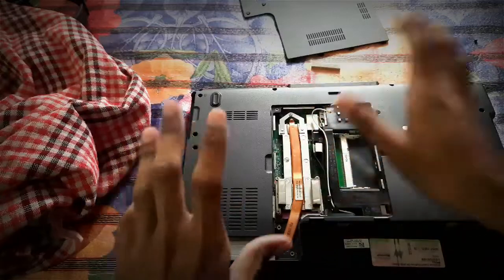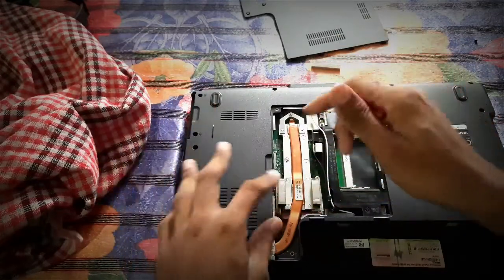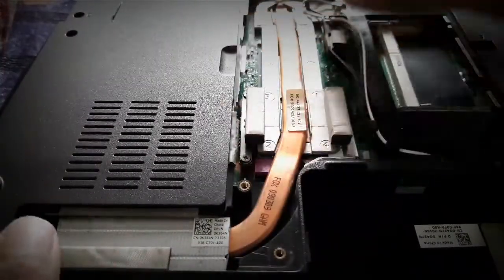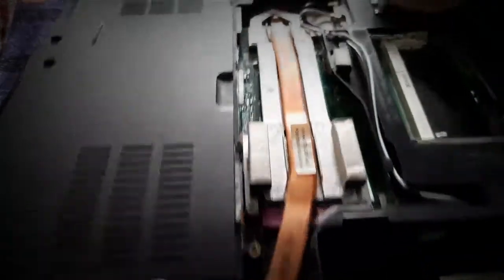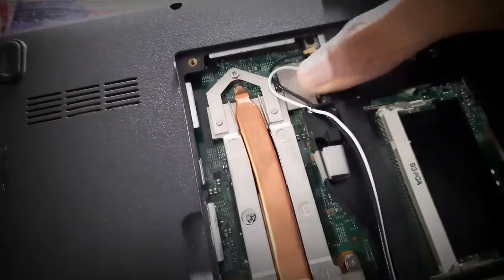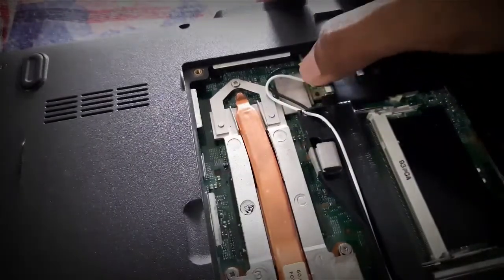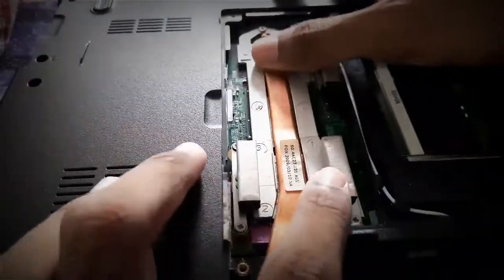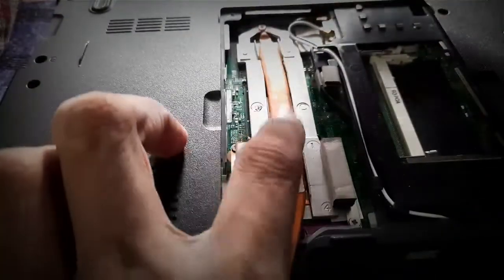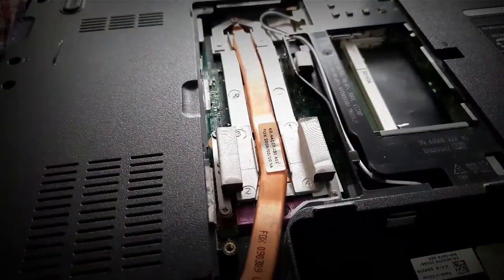This is what you need to do with the hardware stuff, and after this I'll be coming to the software part. Now the heat sink is in place and I've put it very carefully and tightened all the screws. Be very careful — it's not a joke. After that, you have to fix the Wi-Fi antenna cable back here and gently place the wires on top and push them to lock in place. As I mentioned, you need to change the thermal paste if you've been using your laptop for a long time — it will surely make some difference.